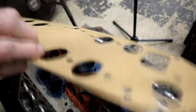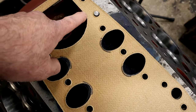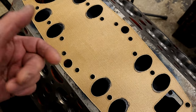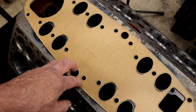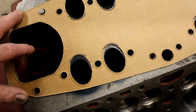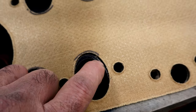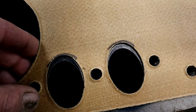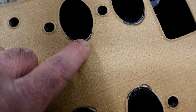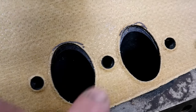We want to go ahead and put this down on the engine. One of the beauties of a flathead Ford is that it has dowel pins, so it's real easy to get the alignment back. On a Chevy, Ford V8, or anything in the high end, I'll actually mock up the intake manifold and the heads with the correct gasket and drill holes in the cylinder head. This is what I want to show you — why is it important to port match? See all that? The alignment wasn't the best — some are right on the money, some not so much, some pretty close, some not at all.